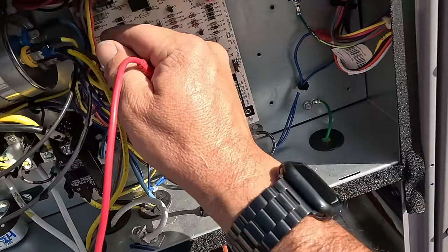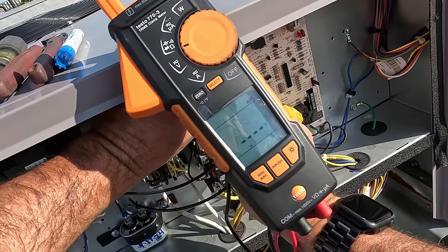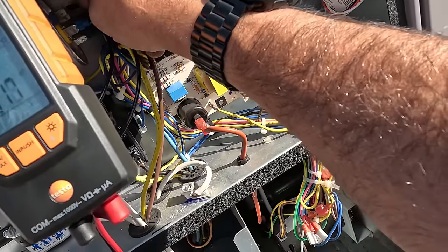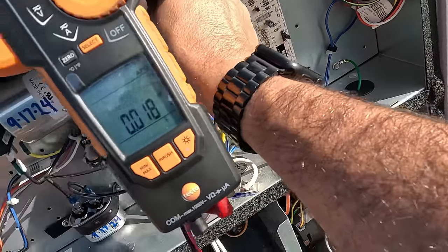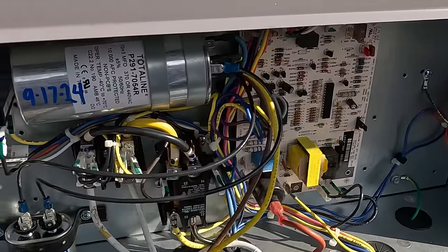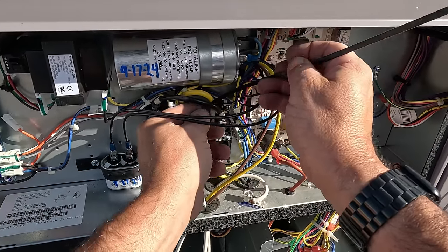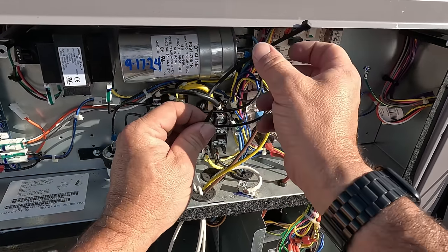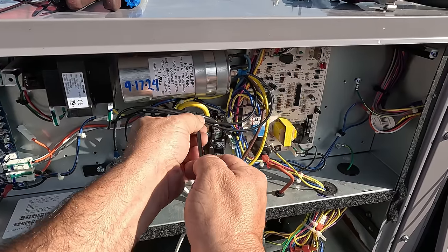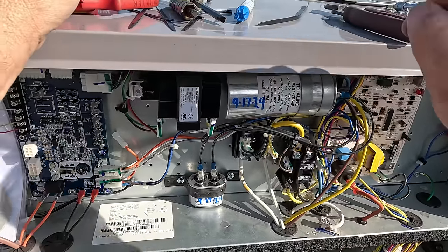Then on the other one, just for making sure, let's go ahead and check the compressor one — unhook the compressor. 1,001... 1,002... 70, 70.0. Beautiful. So we've got that there, got that mounted back up. And then we can strap that wire there to that little spot right there so it's not hanging out in front possibly getting caught on something — keeps things out of the way. Nothing possibly rubs into anything.